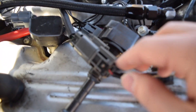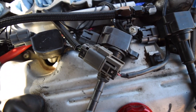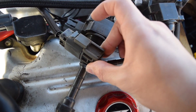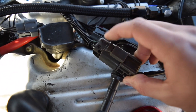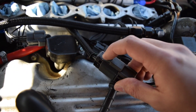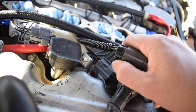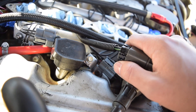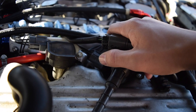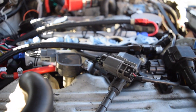Let's talk about the crank angle sensor. This is the wire coming off of it. If you unplug it with the clip on top, the top left is the crank signal wire — so the crank wire from the harness goes to that one. In the top right we have a 12 volt switched power coming from that relay. The bottom left is a sensor ground — it's the white with black stripe wire coming out of the harness, and that needs to be shared by the other sensors as well, so splice into that. And the bottom right is the cam signal, so the cam wire from the main harness goes there.